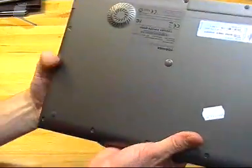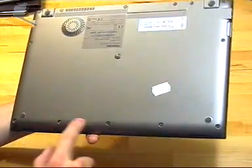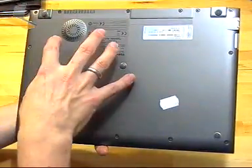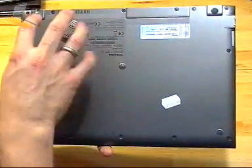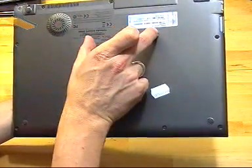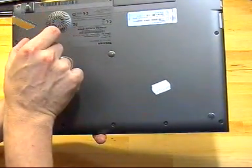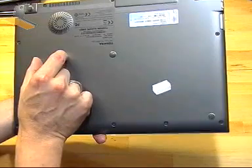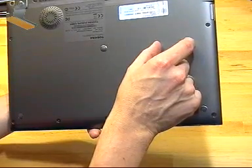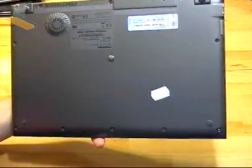Underneath the device, there's the fan. It's not as clean as the UX31 — there are a couple of stickers and screws, which, if you want to break your warranty, allows you to get in and max out the RAM slot. There's 2GB on board, but you can max it out to 6GB by changing the 2GB for a 4GB slot. You can also change the SSD if you find a better matching one, and there's a PCI Express mini slot for a 3G module, though I believe it does have a wired antenna.